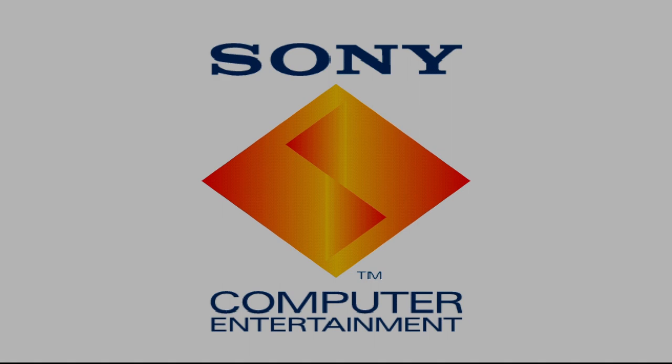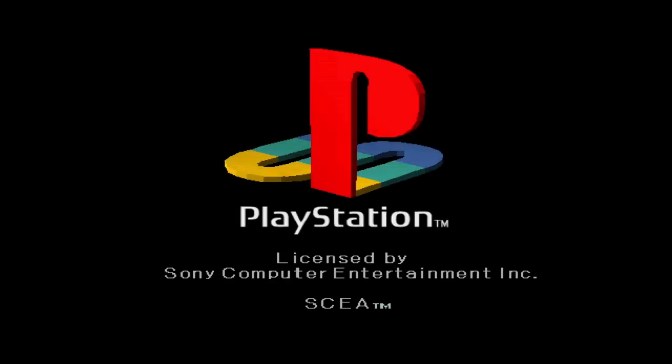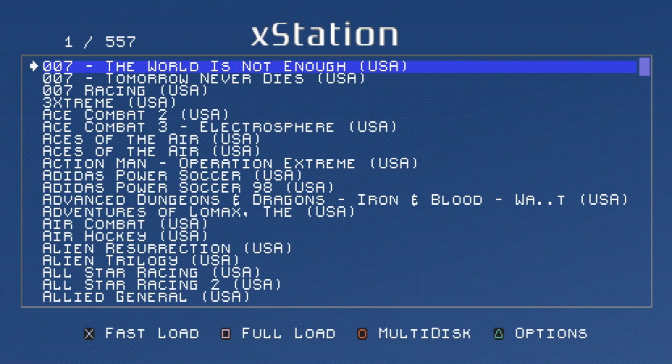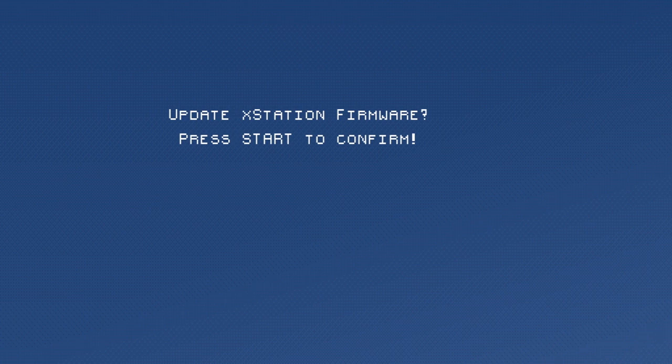Well, here we are. Booting up the Xstation. Keep in mind, the lid does need to be closed, otherwise it won't boot, because of the sensor thinking that there's nothing in there. So here we are. I've already got my games list configured, but yours will not by default. If this is your first time starting it up, I'm hitting triangle here, and I got the new firmware files. If yours is out of the box, yours will need an update as well.